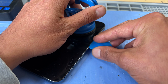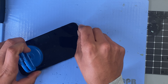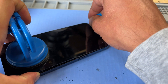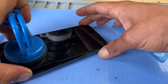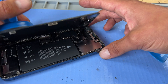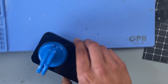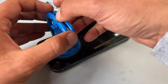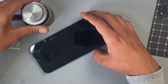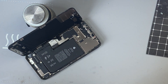I'll add a little bit more alcohol just to loosen it up and then this screen is just about freed. To detach the top edge I create a small gap, just enough to insert the guitar pick, and then wiggle the screen side to side — it should detach from the chassis. Now that we've got the phone open we can take the heat mat out of the way, remove the suction cup, and then add some kind of heavy weighted object to the back of the phone so that we can rest the screen on it whilst we're working.